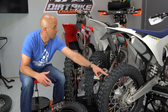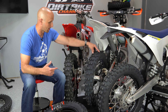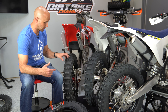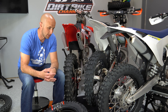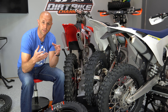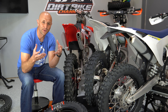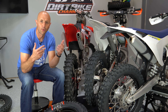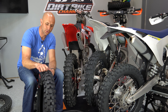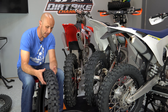The one on the Husky has about 16 hours on it. This one has maybe around 12 to 15, and this one has about 12 hours. A lot of times I don't go more than about 20 hours on my tires, especially on the rear. Because the very best thing you can do to upgrade the performance of your bike is to put new rubber on it. You'll get so much more bang for your buck out of new rubber than a pipe or some other engine mod. Tires are so critical — keep good fresh rubber on there. The suspension works better, handling works better, traction is better. It just helps everything.